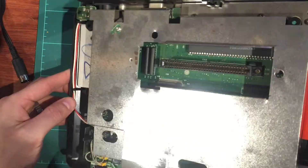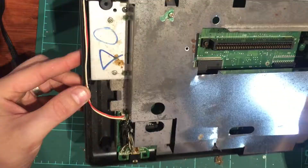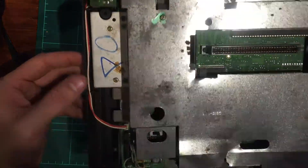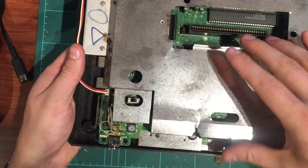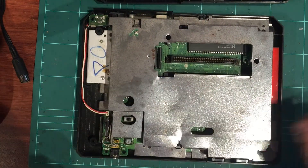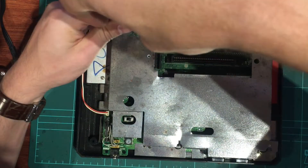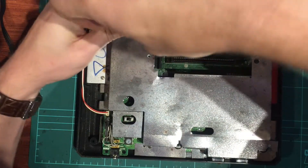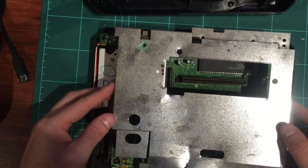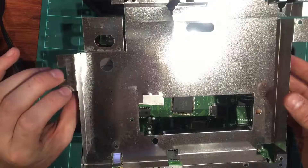Dirty American spiders! We should probably clean this properly as well. Being a high-def model, it's in demand - it's quite a good unit. We'll take all the RF shield off to begin with, see what we're looking at, make sure everything's working, and go from there. Reconnect the LED, pull some screws out and keep going. That's all done - let's lift out the RF shield.